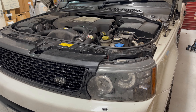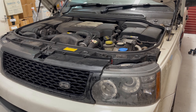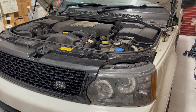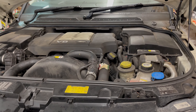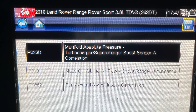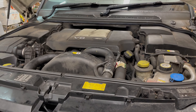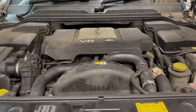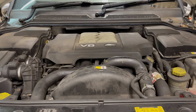Today I've got a friend's Range Rover 3.6 TD V8 and what's happening is it's going into limp mode whenever pushed under hard acceleration or when going uphill. I've checked the codes and it's shown a code for the MAF sensor and also the MAP sensor, which is the manifold air pressure sensor. To rule out the MAF sensor — the codes could have been historic — we erased the codes, went back out in the car, managed to get the car to go back into limp mode, and the only code that came back was the MAP sensor code.